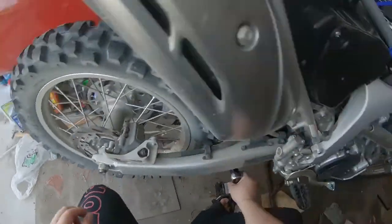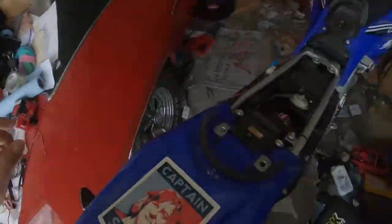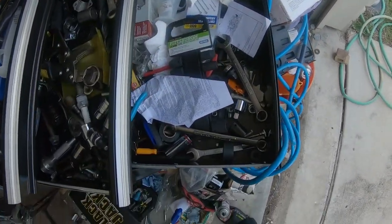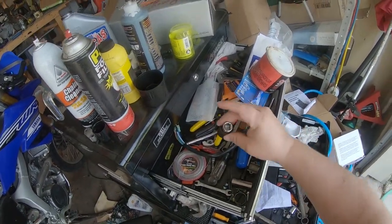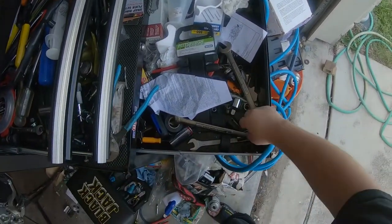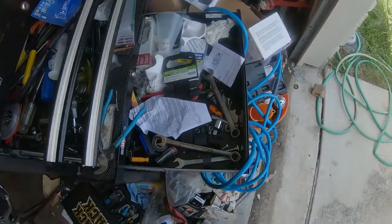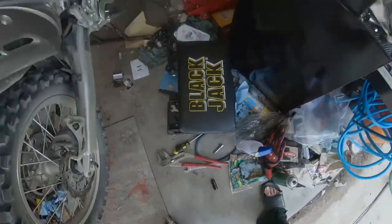I'm going to bust this bottom one loose, hopefully. Let's go ahead. No, actually, the rear's not going to want to go down with stuff missing off of it. Ugh. So, this one down here was at 58 foot pounds. So, one has to eat their Wheaties to get this one off. It also helps to have an adapter here, but. See, I'm going to grab my deep well 19 real quick and get at that bad boy.